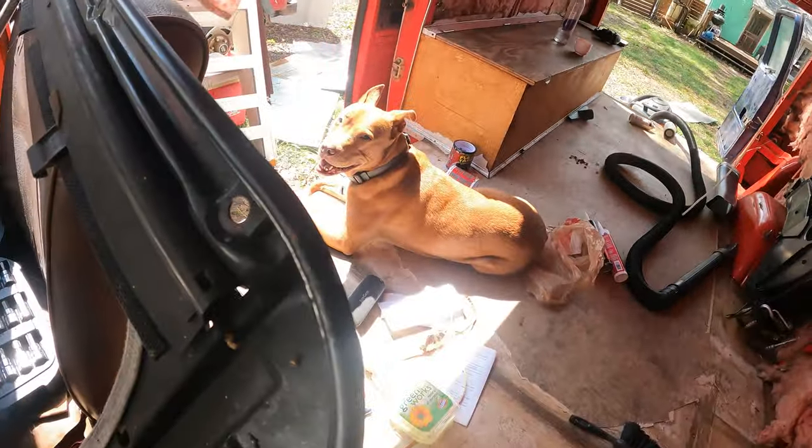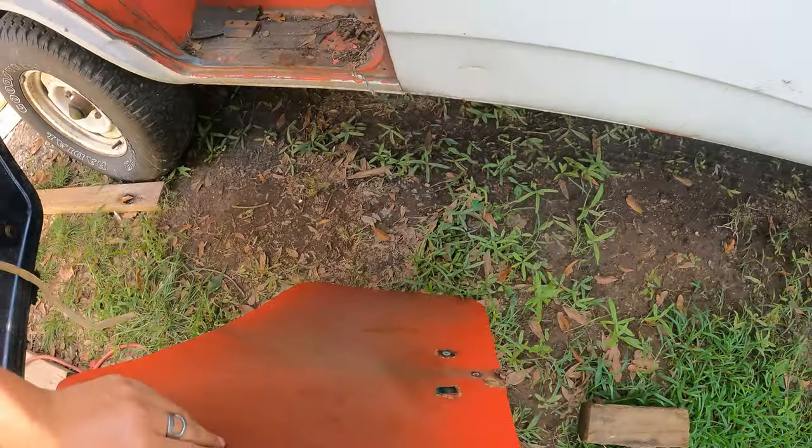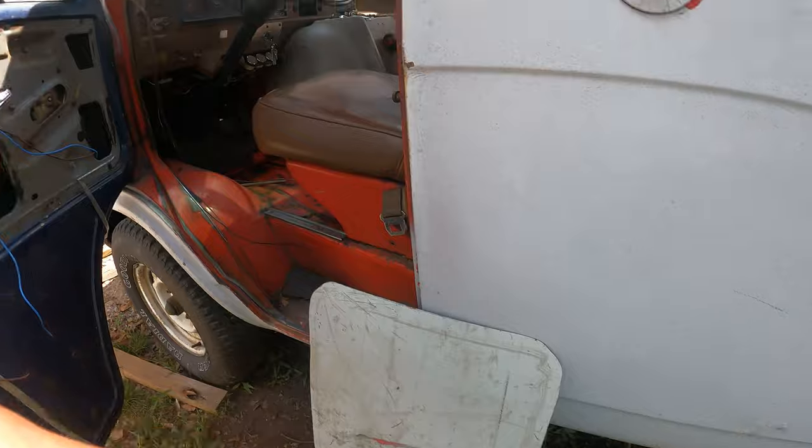My neighbor's super good tree guys are back, so the dog's about to lose her mind. Now, in case you're wondering how to put a sunroof in your van or whatever, it's the same as a roof vent. You basically get the shape of the thing — this is the original roof piece that I saved. You trace your sunroof and cut it out with a Sawzall, a grinder, or a jigsaw. Jigsaw is usually the best in my opinion.